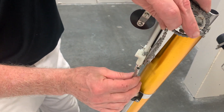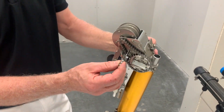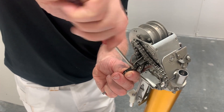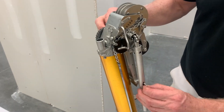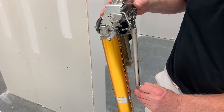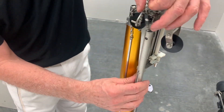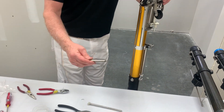Now the chain will come off, and this piece — just so you don't lose it — set it right here. Then push the block in. I actually need to tighten that up just a little bit so it'll go in. Tighten up this screw so it'll ride through the guide. Push this through, and then on the other side we have the chain and the little shroud here. Pull this out all the way through.